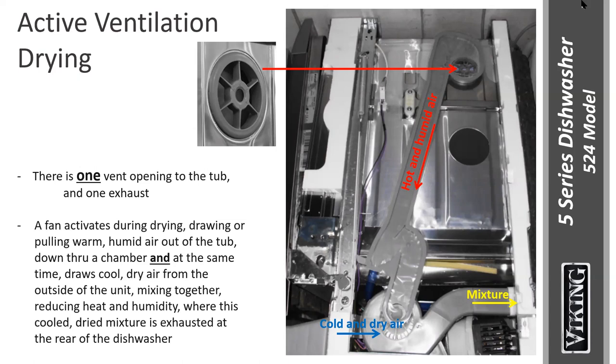Also, you gotta make sure you select the right program. Since the rinse temperature on some of the programs is very low with a shorter duration, those cycles will not give you as good of a dry as, say, the pots and pans cycle we're going to talk about, okay? So it has to do with not just the way the dishwasher performs, but also that you've got the rinse aid in there, that you've loaded it properly, and that you've selected the correct option from that standpoint.